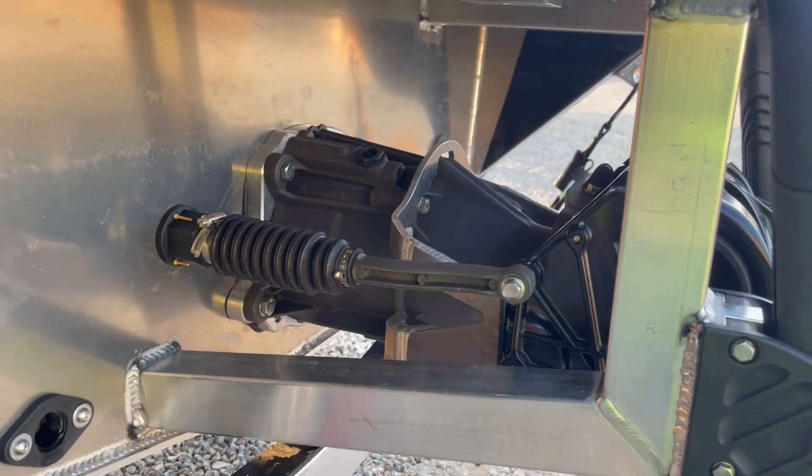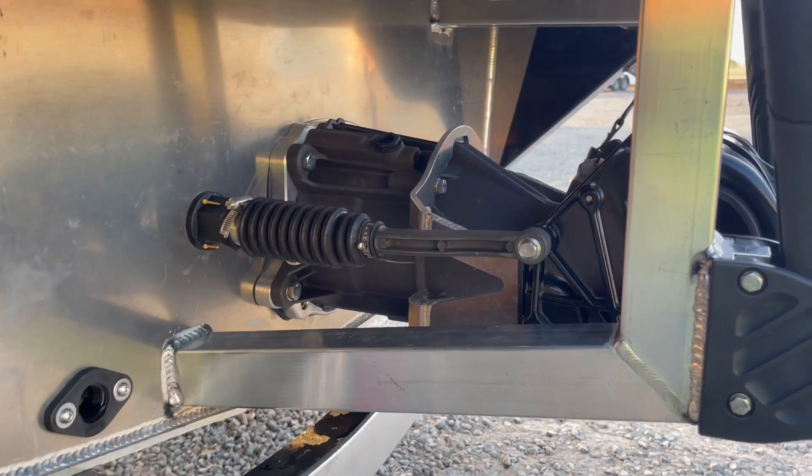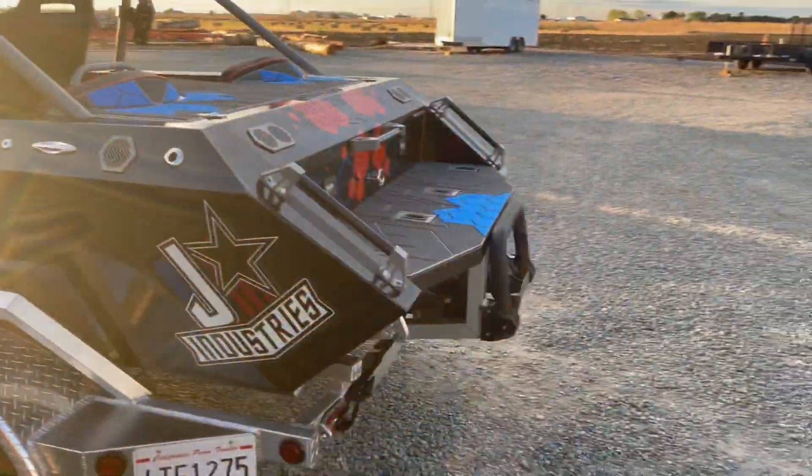After doing that we're going to try to put it in the water today and see if that's going to fix it. The bottom line is the boat has too much trim up and it just won't stop bouncing. With 4 people in it, 22 miles an hour was the top speed without it starting to bounce, and once it started bouncing it was violently bouncing if you tried to get it to any speed at all.